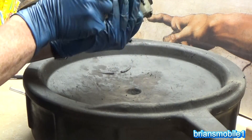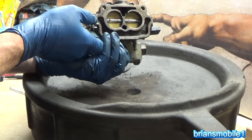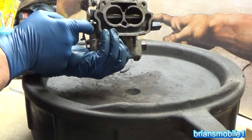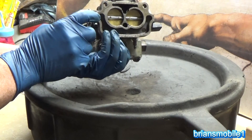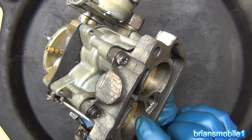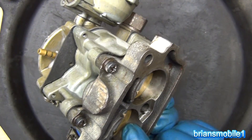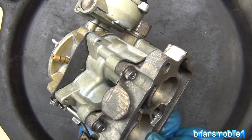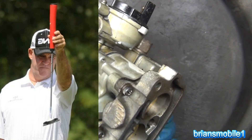In the bottom end of the carburetor, as you can see here, you have these butterflies, and these work with your throttle. So this would be at idle. There are two tiny little jets — one here and here — and that's how you idle. Even though the air is blocked off here, there's a little bypass and fuel goes in through these two. So that's your idle circuit — that's like your putter.